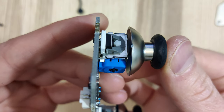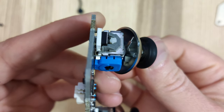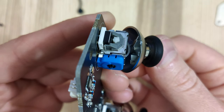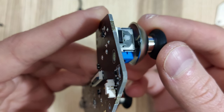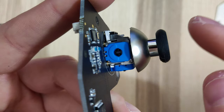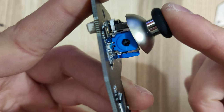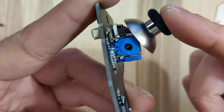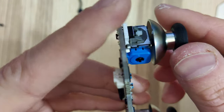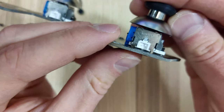Let's take a look at the problem and how to fix it. With the joystick over here, you can see this is where it was actually rubbing on the controller — that's kind of why it felt like there was a notch, because there is. This is not due to damage or wear; this is just the mold they use when making these. Slight variances are going to occur and your model might not have this issue. With the controller open, I did want to make sure the joystick itself was fine — it does seem very smooth. It's just the cap, so we can try to fix that. Luckily, it wasn't on any of the other sides, only on one side, and that's just from the mold they use.